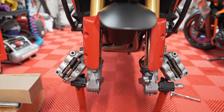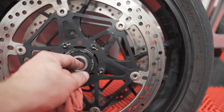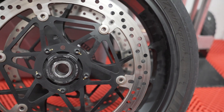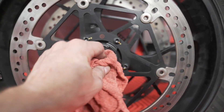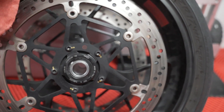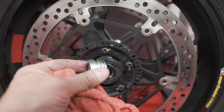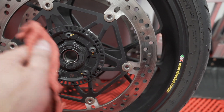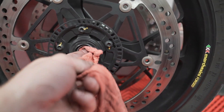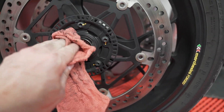This is now a fantastic opportunity to clean your calipers. On both sides of the wheel you're going to feel out the bearings. There's a spacer in here, and you have one of these bearings on both sides. Feel the bearing — make sure there are no rough spots in it. This is brand new, it feels really good. Here's the spacer on the other side. Remember which way it goes in. Feel that bearing, spin it around — it's easier to get grip with a cloth to feel it. It feels pretty darn good.